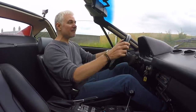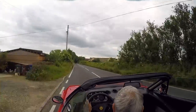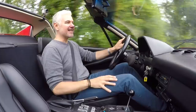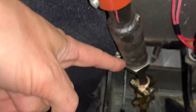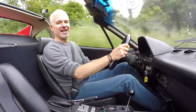Braking, because actually the Influenzo is driving so well. The steering is so good now, and when I went to see Ian, he was absolutely right that something wasn't quite right with it. I had a look and I lubricated it, but then I found out what it was, and it's got the collapsible nut that allows the steering to collapse in the event of a crash. That had gotten loose, so there was some play in the steering. Now that that's tightened up, it is amazing. There's absolutely no slack in it. I'm getting great feel. It is lovely.